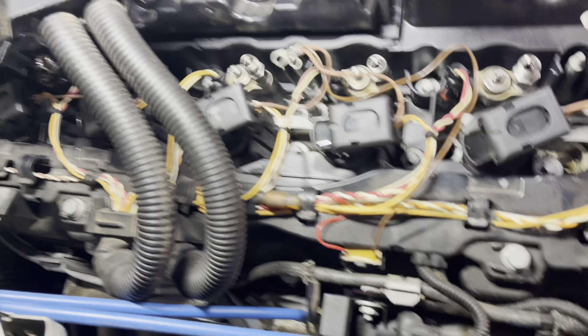The plan is to first get the spark plug tubes out of the cylinders — it'll help clean up everything easier. There are little pinholes on them and I'm going to use a pick, pulling on one side and then the other to get all of them out before I start on the valve cover bolts. I also want to vacuum out as much debris as possible. All the valve cover bolts are loose — I went around with a ratchet first to break the torque, then used the Milwaukee impact gun and zipped them off quickly. The bolts are still sitting in place for now.